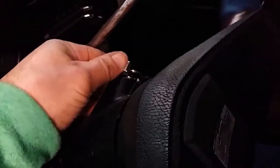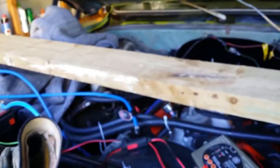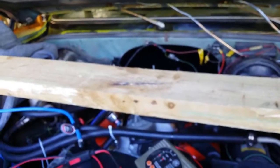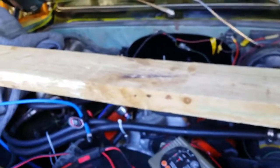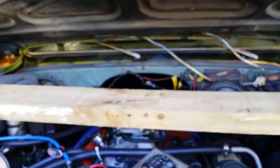These tests were done with the key in the off position. That's the on, and that's the off position. With these tests, I'm getting the feeling that 12 volts is being supplied to the starter motor solenoid, instead of maybe less volts being required, and that could be the actual problem.